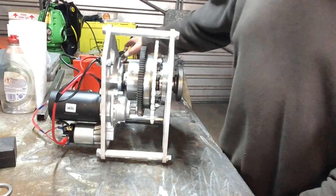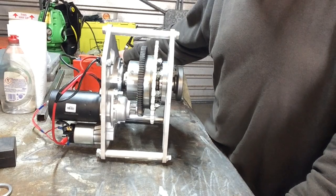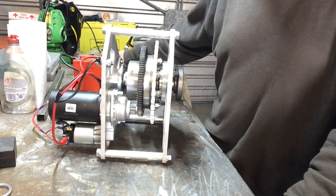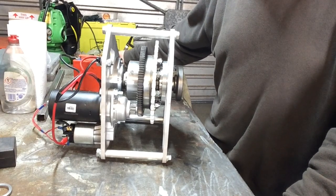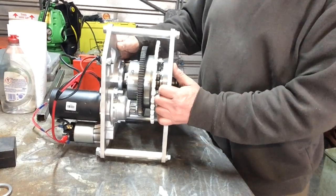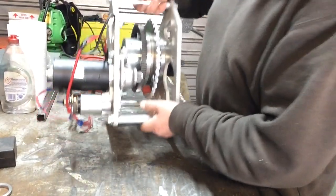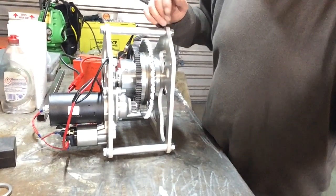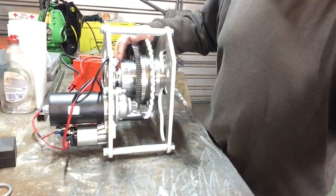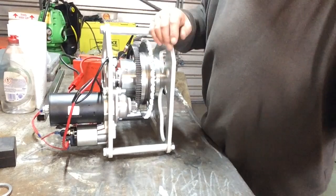In your use you need to use a fairly high capacity battery to drive this if you're moving a vehicle of any particularly great mass. It will move cars up to about 550 kilograms, but on fairly level and smooth surfaces. The whole unit weighs somewhere in the region of 18 kilograms complete with the ATB type differential, output shafts, motor and the mounting cradle.